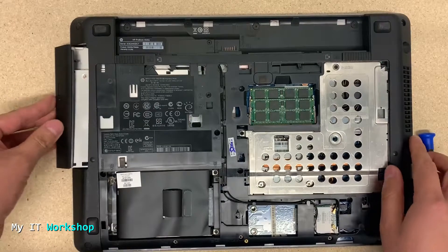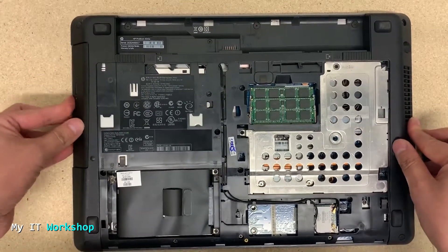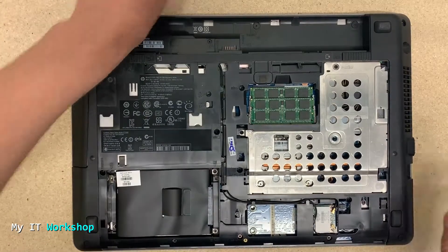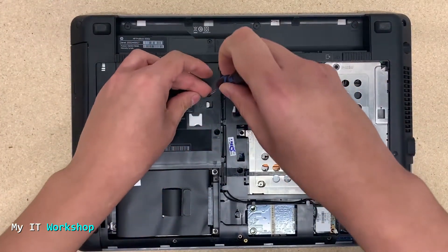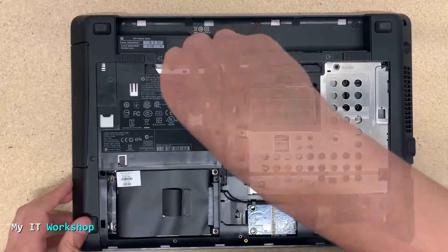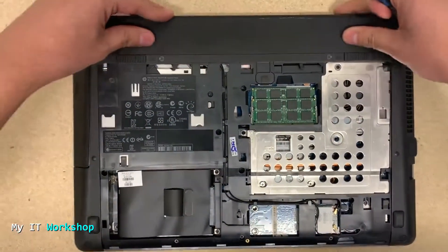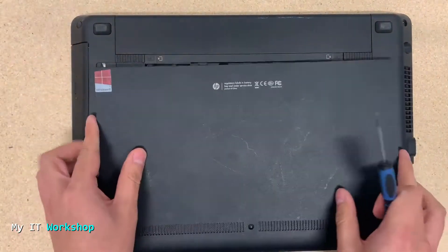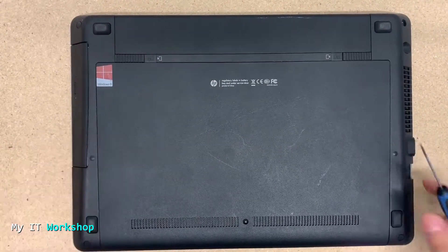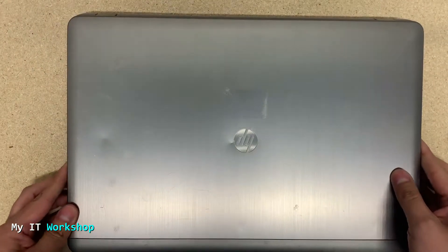As I mentioned, this computer is working just fine — you just put the new drive back in. Once you put it back, you put back the screw, just like that, very easily. In this model it's only one screw; in the Dell one we had to remove two, so this way is easier. Then we put back the battery and the cover for the back part of the laptop.